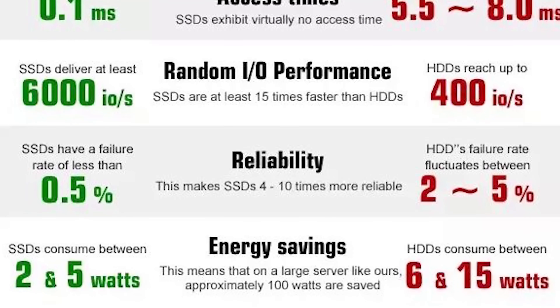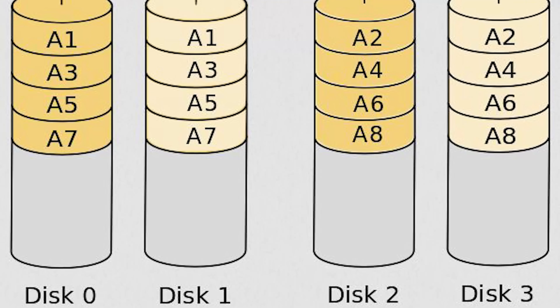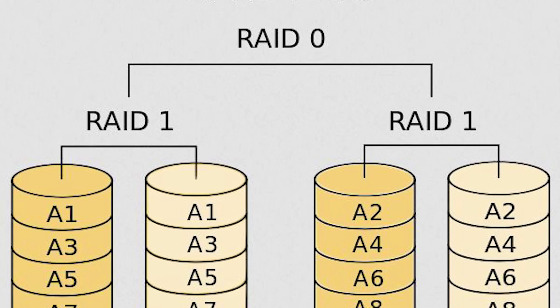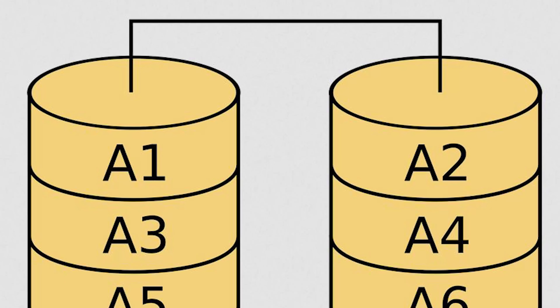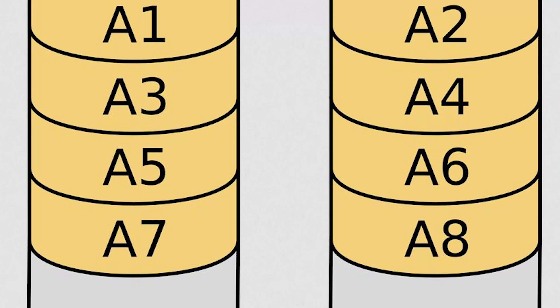Flash devices have a rotating key, making competent recovery from failed devices really difficult. Granted, they are orders of magnitude more reliable than mechanical spinning rust. But if I could show you — at least in Linux, at least in a workstation — that you could use a bunch of these and set up RAID Z1, or RAID 5, or RAID Z2, or RAID 10, you could do all of that with four devices. If you want a striped mirror you can do that. If you want one drive worth of redundancy you can do that. If you just want to RAID 0 them together, you can do that. And the Ubuntu 20.04 installer supports that right out of the box.